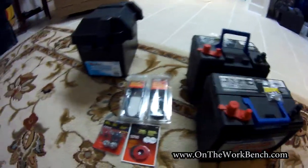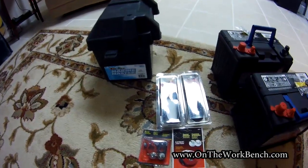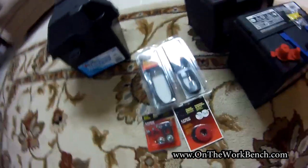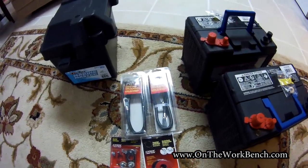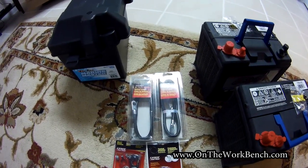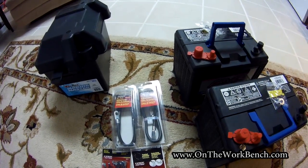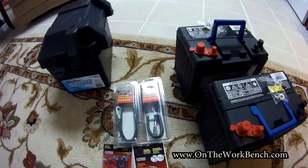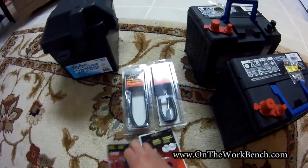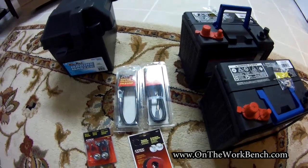There's hardware that comes with the batteries. What I'm going to do — I've got a case for the second battery and I got two extra cables. I'm going to create one of these as a positive terminal with the help of some red electrical tape. I'm going to wire these two in parallel so it still remains 12 volts and the float charger will still charge them both. I'll have two batteries and twice as much capacity with these group size 24 batteries. So now the next task I need to do is assemble these cables — I'm going to have the lugs on one going into the screw terminals on the other.